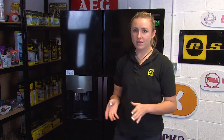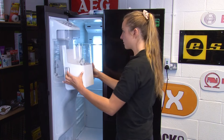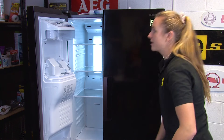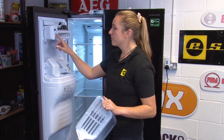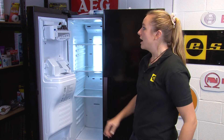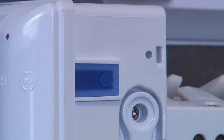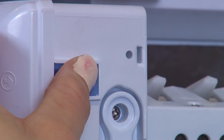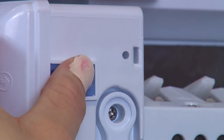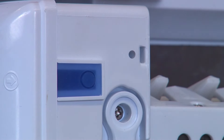If there are no blockages you'll need to reset the ice maker. You can do that by removing the ice bucket and locating the test button, which is a small rectangular button which can normally be found on the front side or bottom of most models. As you can see, ours is this one here, but normally they say 'test' or have an arrow pointing towards them. Press and hold the test button for three to ten seconds — you should either hear a chime or the ice tray motor will start turning. The test will take about six minutes and at the end of the test you may hear another chime. Once it's been reset, it can take up to 24 hours for the ice maker to start creating ice again.